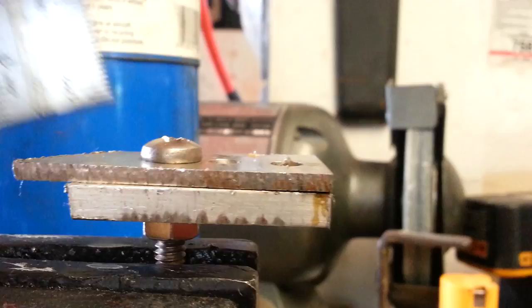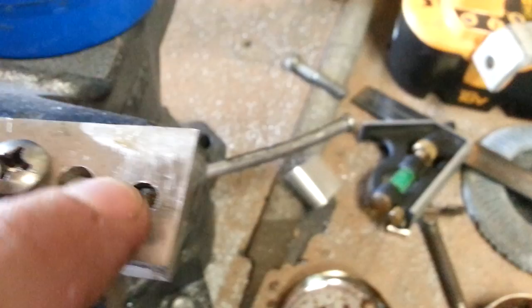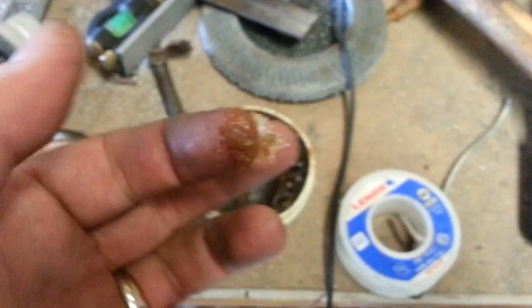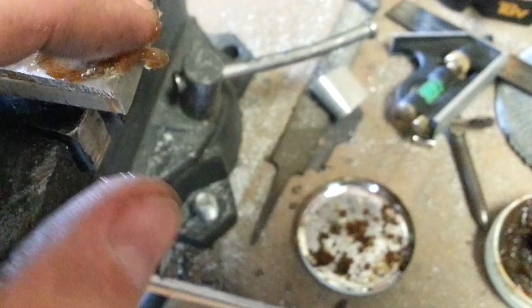What I have here are two pieces of scrap aluminum clamped together, drilled a hole and bolted together — it's about 3/8 inch. I drilled a quarter inch hole down through the top plate halfway through the bottom plate, then a 3/32 inch hole in the side where I'm going to insert my cable to fasten it to a solder pool in this orifice. You can see the shiny flux already packed in — I've used regular plumber's flux, just pack a finger full into the hole until it starts to squeeze out the side.